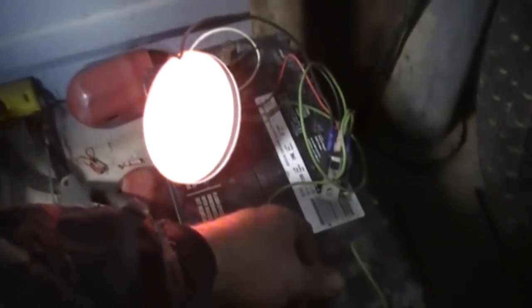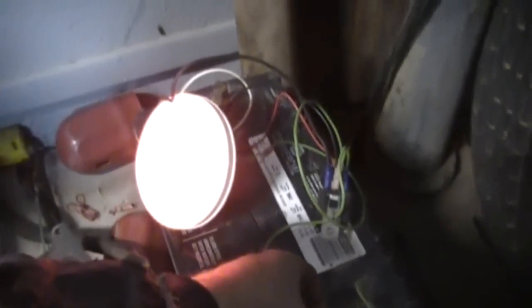I've hooked this up with a light so you can see how it works. This wire represents your ignition switch — when you turn it on you can have a warning buzzer or light come on like that, letting you know the system is armed. The buzzer would be buzzing but the car won't start. That light that's lit is just for show now.